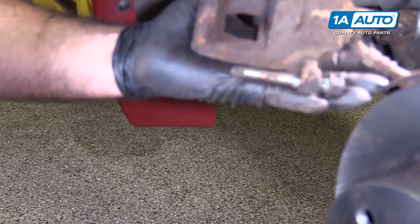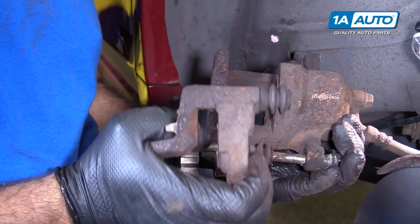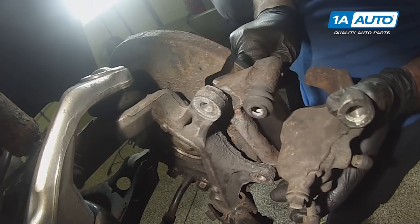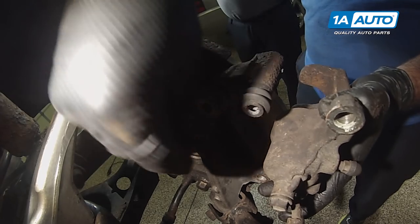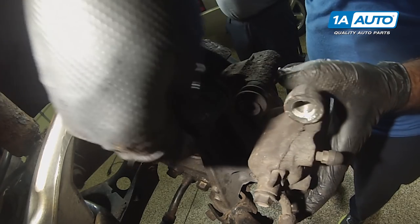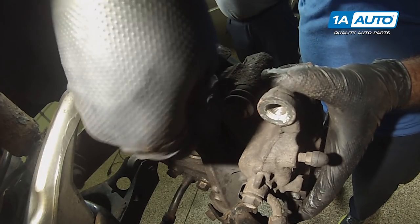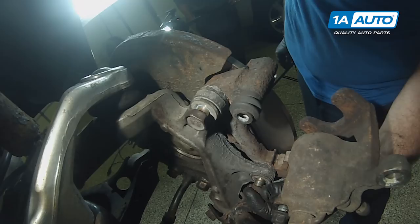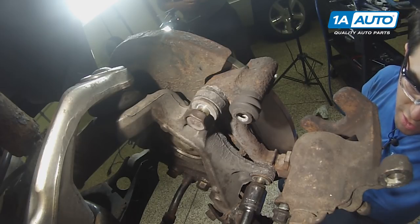It's going to sit here. Because the suspension arm is in the way, I can't slide it in. So it needs to sit like this. Now I can line up the bracket. Capture the top bolt. Now I can capture the lower bolt. Start tightening the bolt.